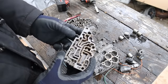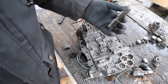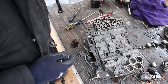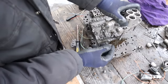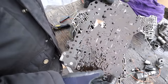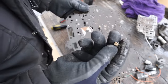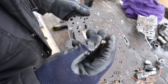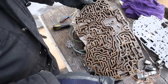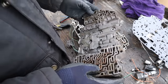There's a lot of little stuff coming out of here — it looks like a brain, kind of a maze inside of there. There's a bunch of these little springs and buckets here that act as valves. Here's the gasket. This transmission fluid does not look very clean — it's very dark brown and kind of pasty. When you take apart the valve body it gets pretty messy. There are more spool valves in there, and you can see there's also this gasket — it's kind of got its own circuit on there. Look how many little check balls and valves there are on here. When you're rebuilding this, you have to put these back in the exact spot. You can basically think of it like a printed circuit board, but a physical one that you can actually see and understand.